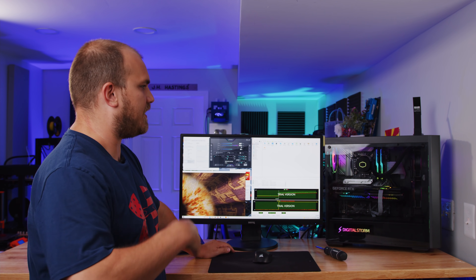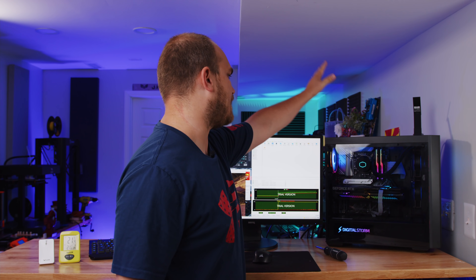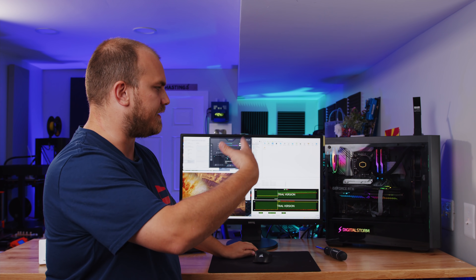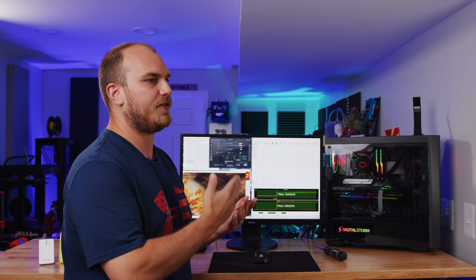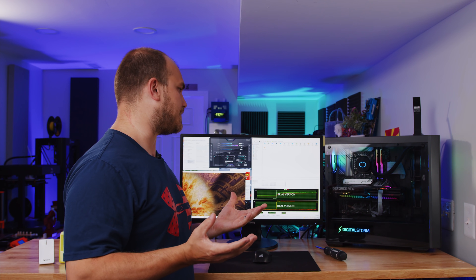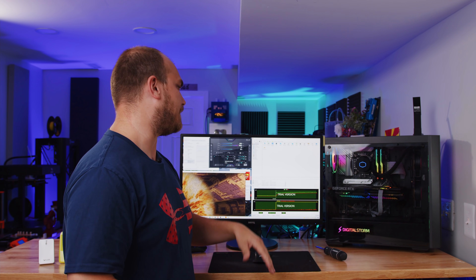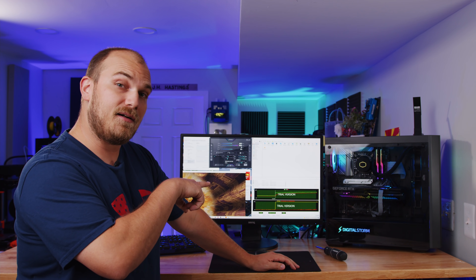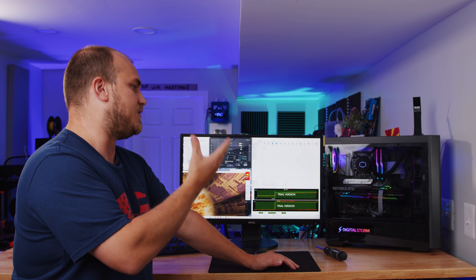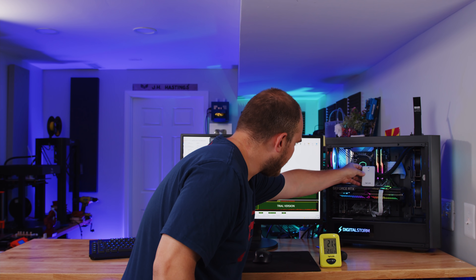The first thing I'm going to do is run a stress test for about 10 minutes to get the AIO heat-soaked. It's set up like a normal case AIO in the front bringing air in to cool the CPU, then exhaust out the top and back. I also have FurMark going just to generate some more heat. I have MSI Afterburner installed, and I want to lock the fan curve — I have it set to 80% — so for all testing the GPU fans are always at 80%. The case fans can do whatever the BIOS thinks is necessary, and I've bumped the power limit and temperature limit up. We'll run it for 10 minutes, let the loop get soaked with heat, then we'll find out how hot the case and GPU get after about 30 minutes, and then we'll do some modifications.